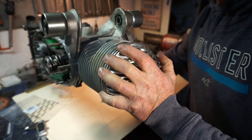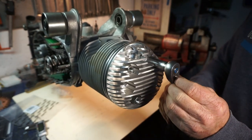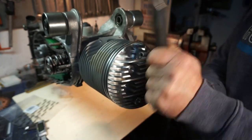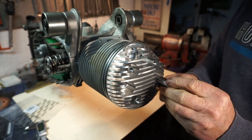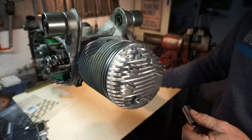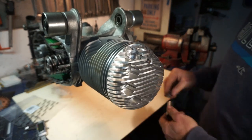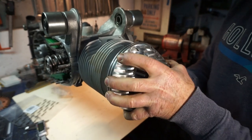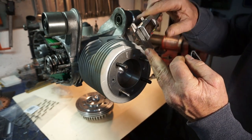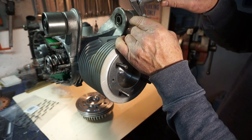Right, that's better. Okay, that's good. That felt nice. It sort of crushed it quite easily, and I didn't have to put too much force. So let's have a look what our squish clearance is with this setup. 1.2 would be rather nice, but we'll see. 1.3 will still pass. So let's have a look. Zero this baby. Check on this part. 1.17, that's okay.